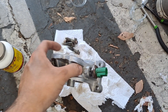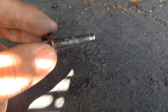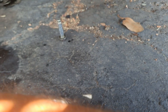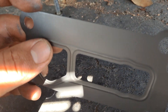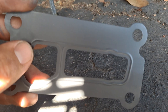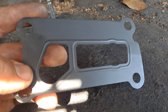I'm going to start putting this on and connecting the connector for the sensor. I put some anti-seize on this — it's a high heat and vibration based anti-seize so it should withstand the pressure. I have to get the new gasket. Here's the new gasket — it only goes one way; it has a little bevel, and one side's pressed in and the other side pops out. The side that pops out goes against the motor or the block — the orientation won't allow you to put it in wrong.